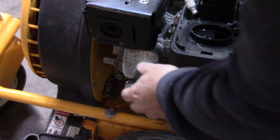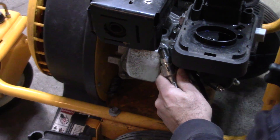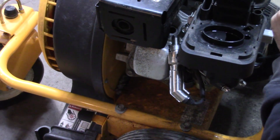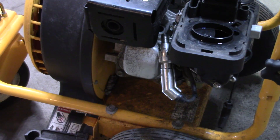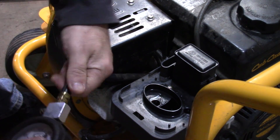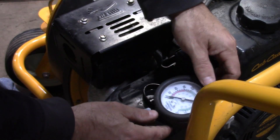There is spark. I wasn't seeing it there, so I'm switching plugs because the other one looked like it was actually flooded. Hopefully you can see that there is spark. I'm thinking there's actually weak spark, so I'm going to check the compression — I haven't checked it yet.